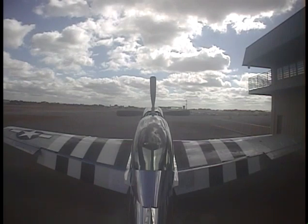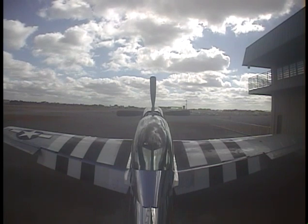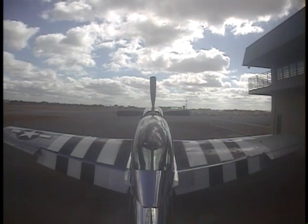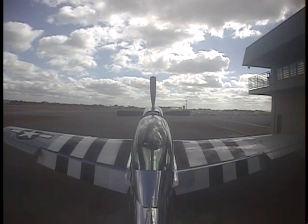I'll need to, with this crosswind, I'll be pulling it back pretty good on landing, okay? And then full forward stick. When the stick's full forward, the tail wheel's mechanically removed from all the mechanisms, so we can basically check the rudder travel without spinning the tail wheel around. Now, if the stick is anywhere but full forward, for the most part, when you move the rudder pedals, it's actually steering the tail wheel also. It's kind of the way that works.